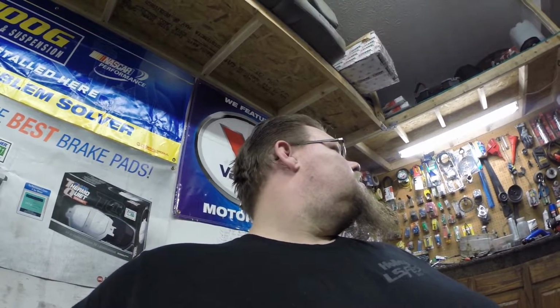So we'll get that going, and it's just a matter of hooking up the wiring and putting the fluids in. I'm going to prime the oil system once it's in the truck. I didn't want to change the oil filter yet because sometimes it's easy to dent the bottom dropping the engine in, so it's still got the old oil filter on it right now. Once it's in place, I'll change the oil filter, prime the oil system, and put it all back together. So we'll switch over to some time lapse, and you guys can watch us get the engine put in, and we'll go from there.